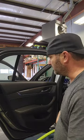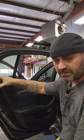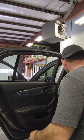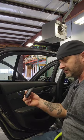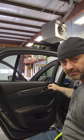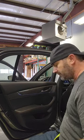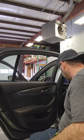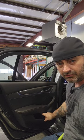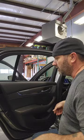I'm a bottom loader, by the way. You cannot pull this panel back to get the seal because there's a little plastic piece back here that you'll snap off every time. To take it apart: pop off the little plastic plate behind the door handle, remove a seven millimeter bolt, pop one out directly under the door switch, grab from the front corner, pop it out all the way around, then pull the seal. Super easy.